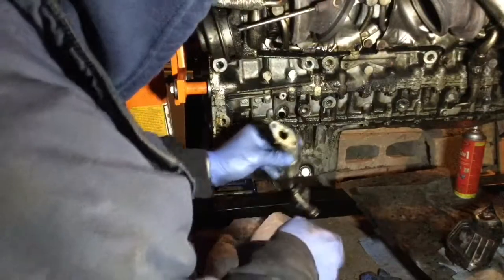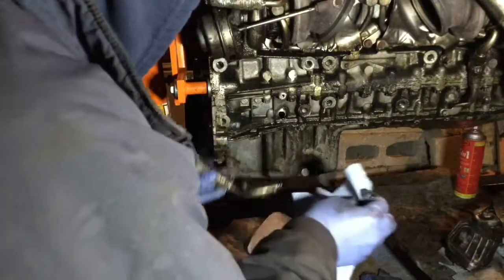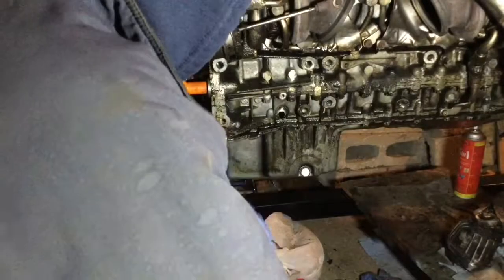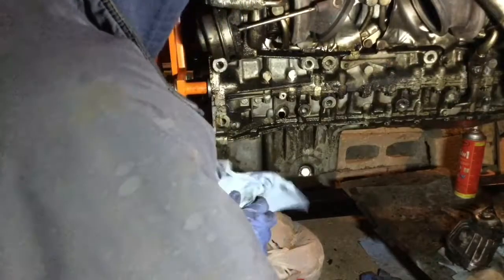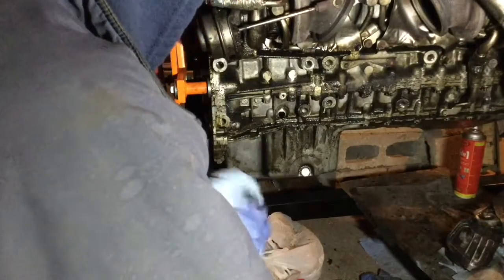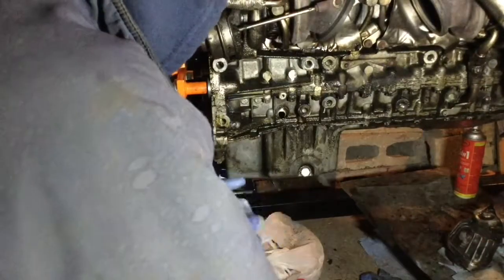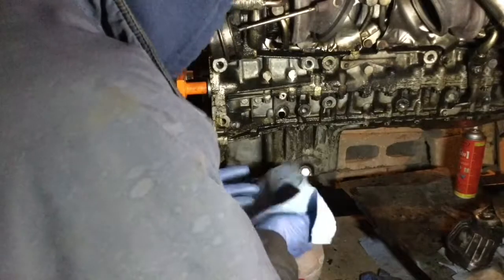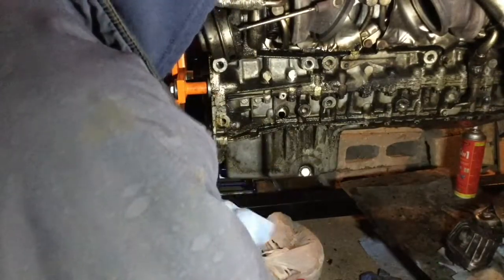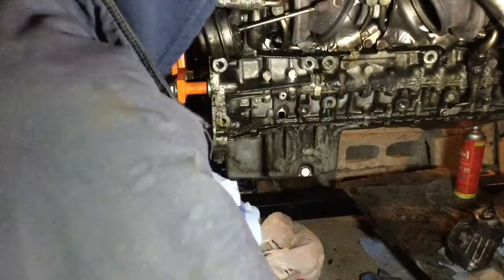So that's the little seal that was on top here underneath the turbo. Of course these need to be replaced — you can see the flange here, and the other one is an o-ring. So I'm going to replace all the o-rings. This is a hard-to-reach spot, so sometimes you don't have the time or budget to do the job once, but then you definitely don't have it to do it twice. For a matter of a dollar an o-ring or a few cents, you want to get all of those new.